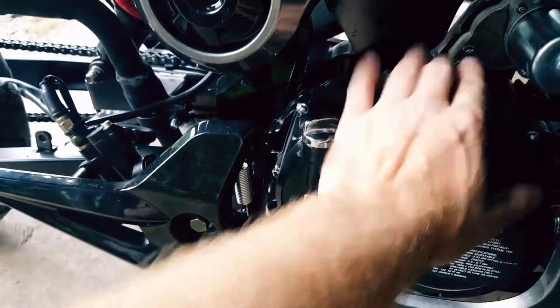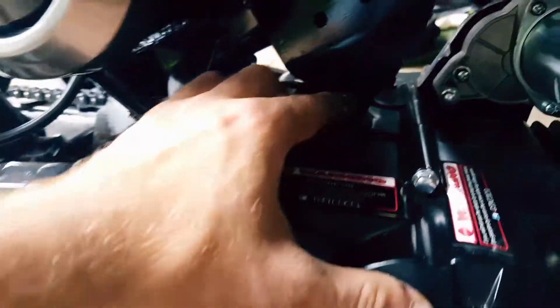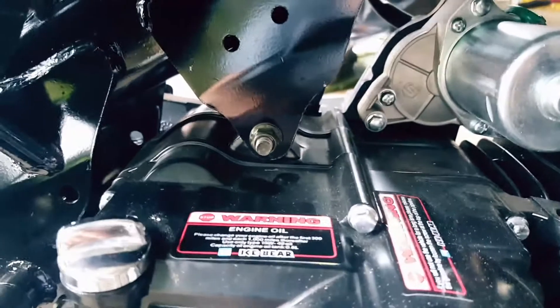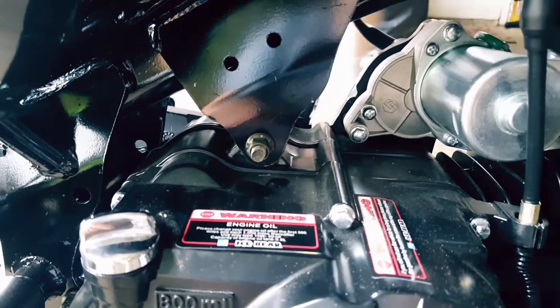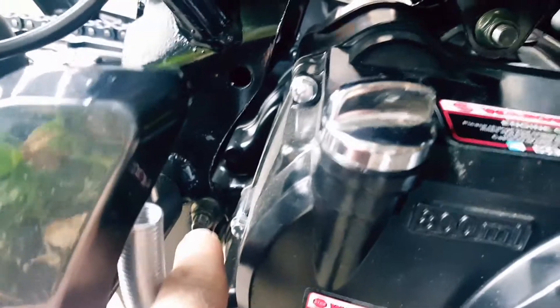On the Hellcat down here you'll see this bolt — yours has two motor mounts as well, and they go the whole way through the block from one end to the other. As precaution, take those off, put red loctite on them, and add a lock washer with a lock nut. If you need to get them off later, just add a little heat from a hand torch and the red loctite will release. For extra precaution, add a jam nut — another lock nut — on there too. Same thing goes for the lower mount.